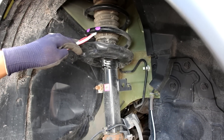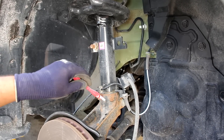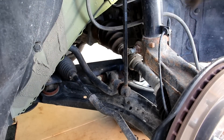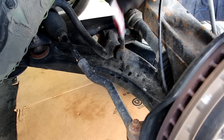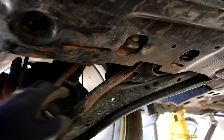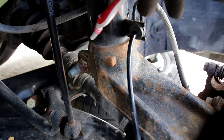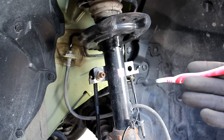The front suspension on the Qashqai is a McPherson strut setup, which is what you'd expect in this class. There's a tie-in for the stabilizer link and a steel steering knuckle — already starting to show surface rust. At the bottom is a stamped steel lower control arm that's pretty easy to replace. We've got inner and outer tie rods here. Looking from behind, steel knuckles have a bolted-on style ball joint, which is good because you don't need a press to change it. However, the ball joint at the bottom is pressed into the control arm, so you'd need a press or would have to replace the whole control arm. One thing I dislike is that it uses a pinch bolt to secure the strut, which can weld together with rust over time, making strut replacement very difficult. Overall the suspension will be pretty easy to work on and easy to replace parts when things wear out.